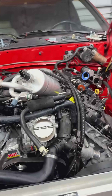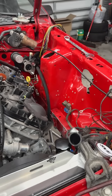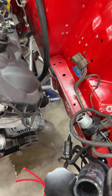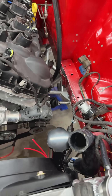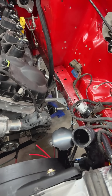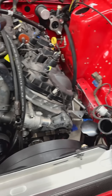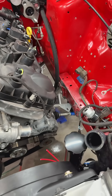What I didn't know was how extensive the sway bar relocation kit is. And that is why I'm cutting out the original sway bar brackets with the engine in and the engine bay painted, because I didn't do enough research. So don't do what I did — before you paint your engine bay and before you put an engine in your car, cut those out so you don't have a mess on your hands like I do.